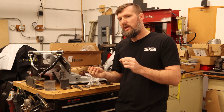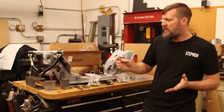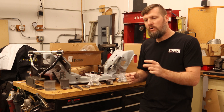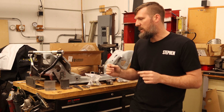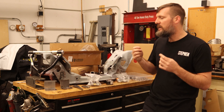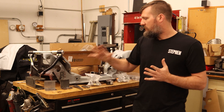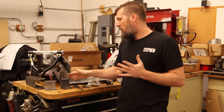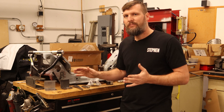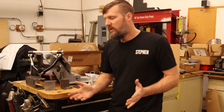What I really want is one inch or two inches higher, which aligns with the Maximum Motorsports K-member — they have two holes, one inch and two inches higher than stock. So I'm going in the right direction. But from the build video, we know the lower hole does not work with the stock control arm — it's too short. So I'm going to be building my own, as I mentioned in that video.